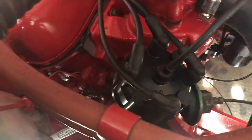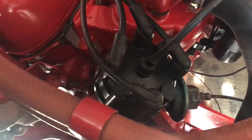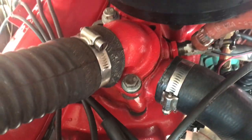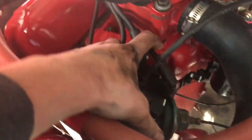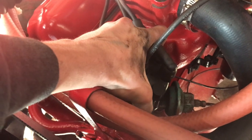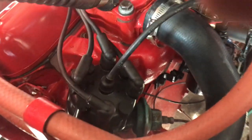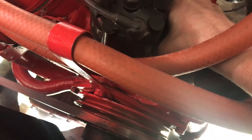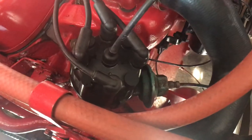I have my timing hold-down strapped there. All I'm going to do is loosen it about half to three-quarters of a turn — just enough to get it loose, but you don't want it dangling freely in the block. You don't want it to where if the wind blows it's going to move the distributor. You want some force required to move it. A good way to check it is if you can grab the cap and rotate it — if you can just nudge it with some control, that's ideally where you want to be.